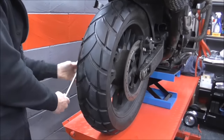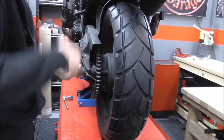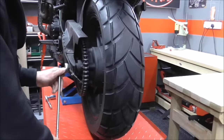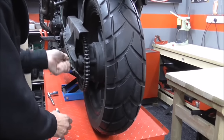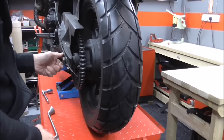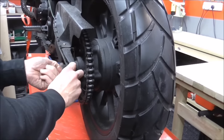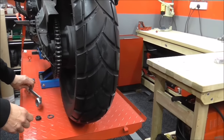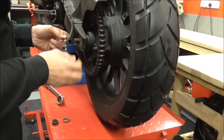The first job, obviously, is getting your offending wheel out. In this case, the back wheel - front wheel bearings can go as well. So that's wheel off the ground. Adjusters right forward to give yourself loads of room. Wheel nut off. In my case here, washer out of the way. A little trick - put it in order: wheel nut, washer.